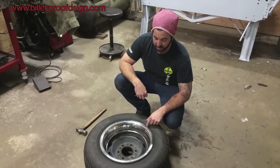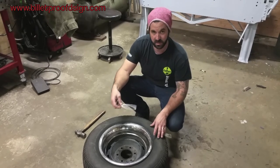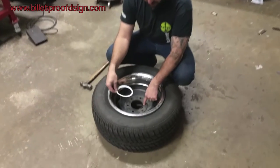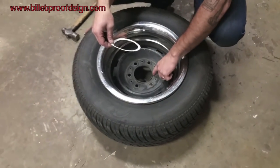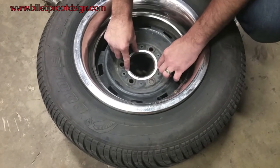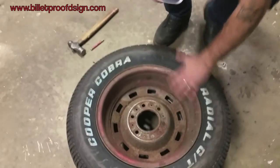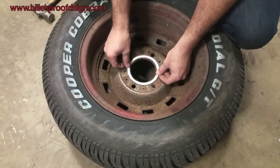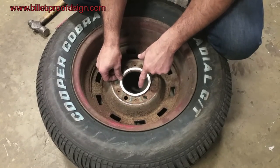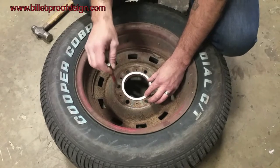Here's our victim — a rally-style wheel, 6-lug in 15-inch. Now we're going to mark the locations for the securing fasteners that attach the collar to the wheel. Once you have everything cut out on the template, the ID is the same size as the flange on the wheel. In this particular wheel there's a good bit of dish, so if you lay the template over the flange and go to center punch it, it's going to deform the template a little. What I like to do is mark it and center punch from the back side. It's very easy to get it centered up — you can use some masking tape if you like — basically making the template ID and the wheel concentric with one another. Go ahead and center punch it, and as you do, be sure the template does not move otherwise nothing is going to fit.